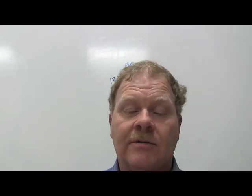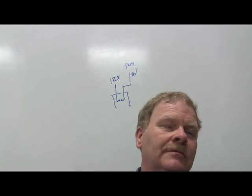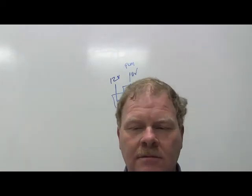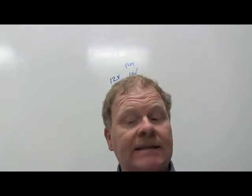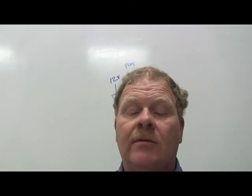This is cool. We've got pictures on this next page here. What does the post or downstream oxygen sensor measure? B. How well the cat is doing its job. It's basically measuring the amount of oxygen behind the catalytic converter, how well the cat stores oxygen. That's always right.